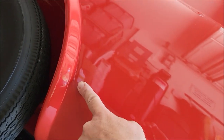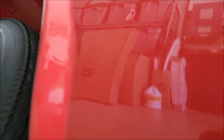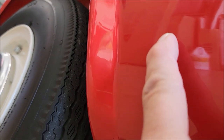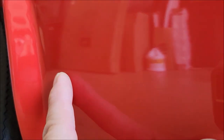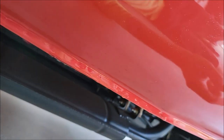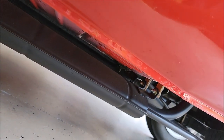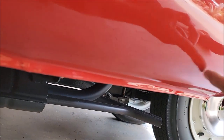A coating thickness gauge is only going to really tell you total thickness of all of the substrate. This thing's pretty dirty. I've got to address this overspray and do a little figuring on these bubbles — I don't know if it's rust underneath; I don't think so because the body's in great shape. These could just be dust nibs. I can show you right here is one, and there's one there, and another one right there that looks like a dust nib to me.